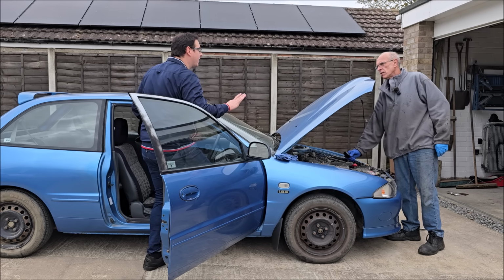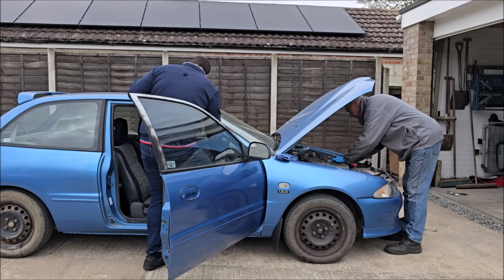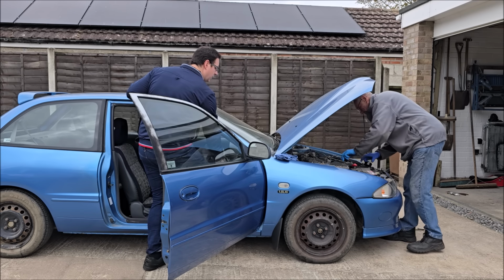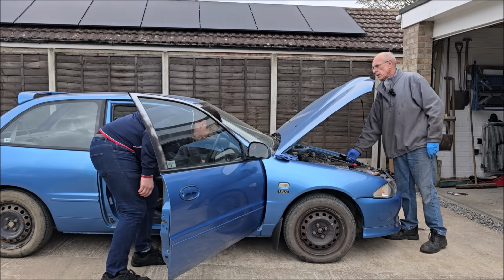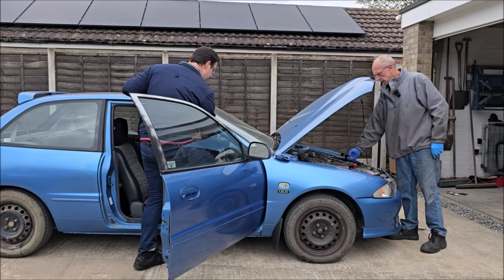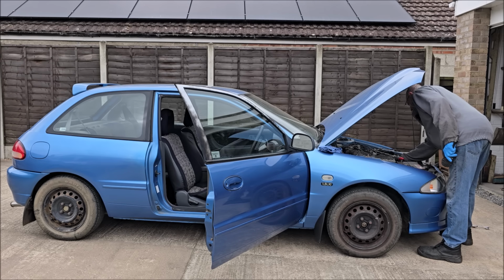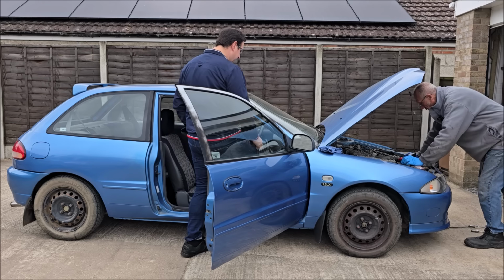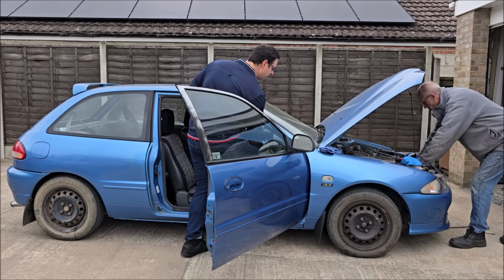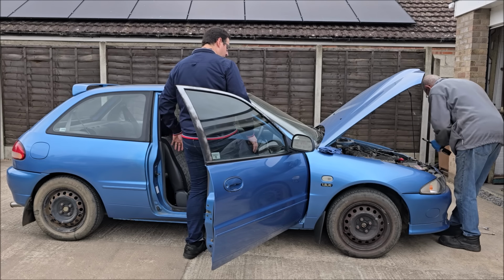So my foot is what? Pedal to the metal? Yeah. Hang on. Just wait a second while I disconnect the distributor. Right, me old mate. Pedal to the metal. And it's out of gear, is it, son? Double check. Don't want to run you over, mate. Yep. Right, crank her over then. Ready? Yeah, go on, mate. Hang on. You've actually gone and got the better one. Yes. The other one didn't work. Okay, son. Ready again? Yeah. So pedal to the metal, just spin her over. Okay, son. What could you see? 165. Ready again? No, I changed this thing over to the next cylinder.